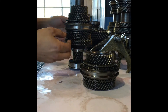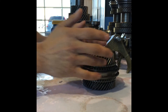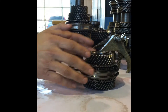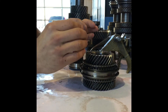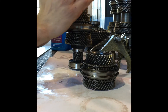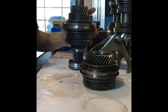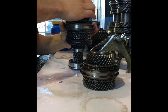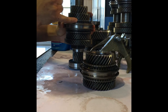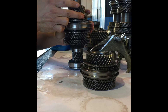The reason it pops back is that inside these synchronizers there is a spring and what some people call dog keys, dog bones, or alignment keys — wedge keys that have a ball bearing and spring that help shift the synchronizer up to the gear and hold it. Now whenever you're engaging, I can tell just by light pressure the synchronizer immediately starts to put resistance on the gear. I can free spin it and with just slight pressure — not even lifting the gear assembly up — it stops.